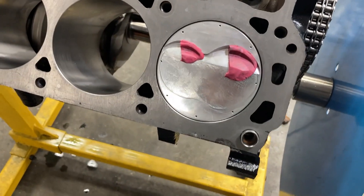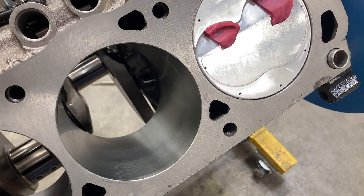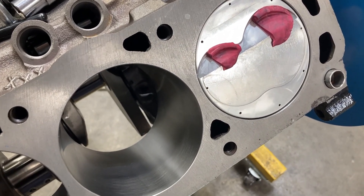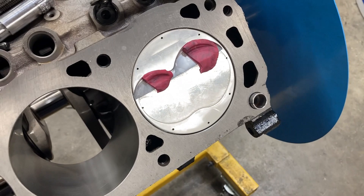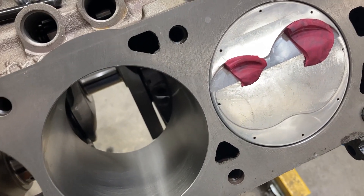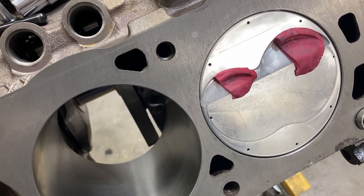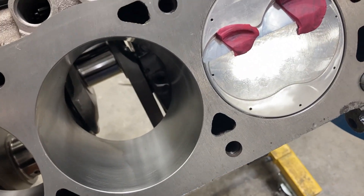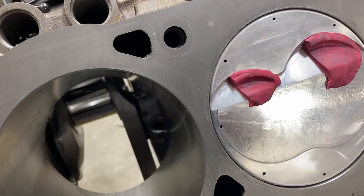I had 88 thousandths yesterday when I measured, and everybody says 100 is the number. I've really never had an engine this close on piston-to-valve clearance, so I've never had to scratch my head about it. But you really don't learn unless you try stuff. A lot of people aren't professional engine builders and a lot of that stuff floats around the internet, so if you just go by what everybody else says you may not ever learn anything. I'm going to try this 85-90 thousandths and go with it.